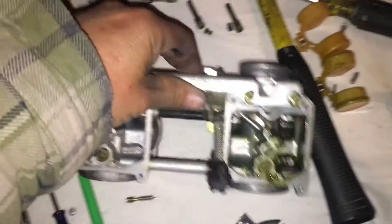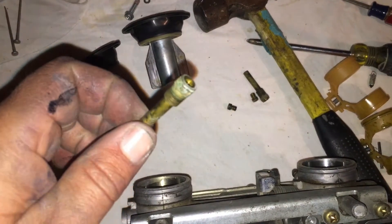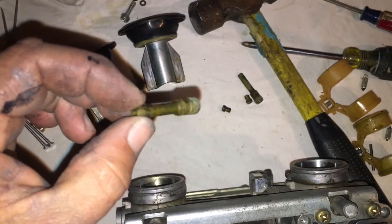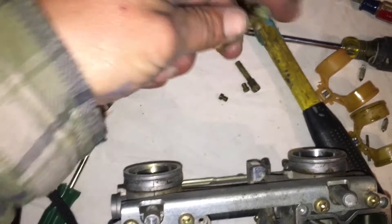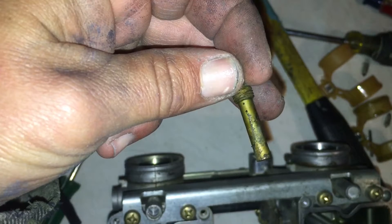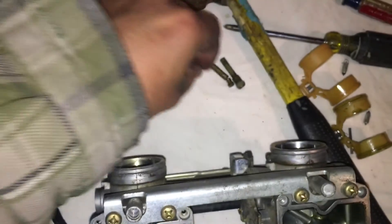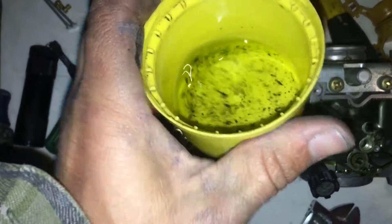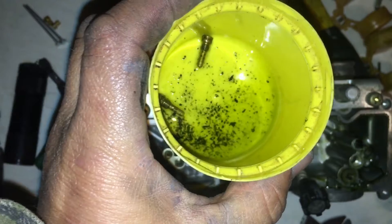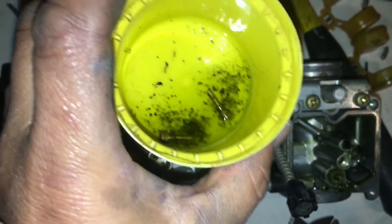All my parts on this '94 EX500 have just been sitting for too long — everything needs to be cleaned out. That's your main jet holder with all the little holes that need to be cleaned up and opened. Here's your main jet — that is a 130. That needs cleaned up, and I had those soaking with the idle jets. All the gunk and crap that came off of them is now soaking in carb cleaner. They'll probably come pretty clean but I'll still need to make sure all the holes are open.